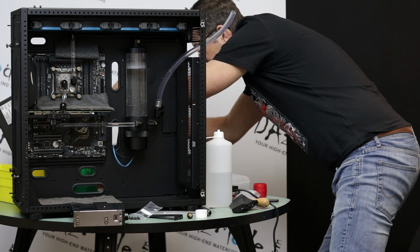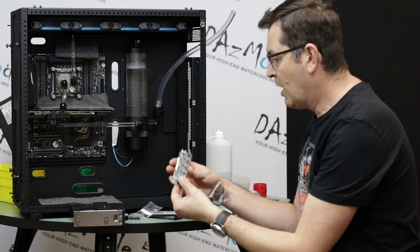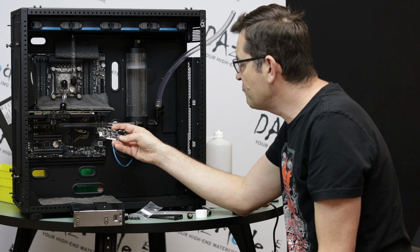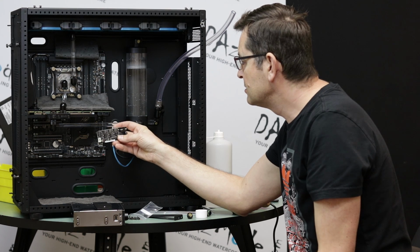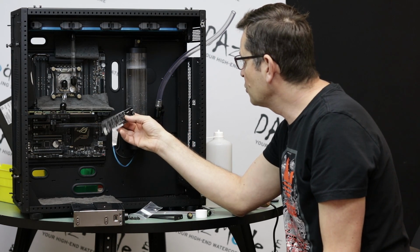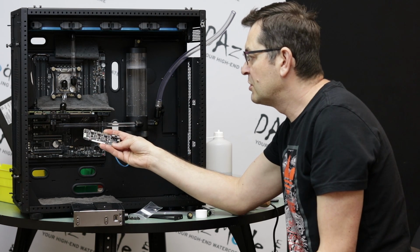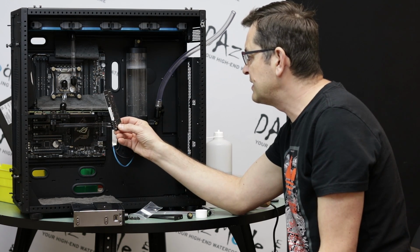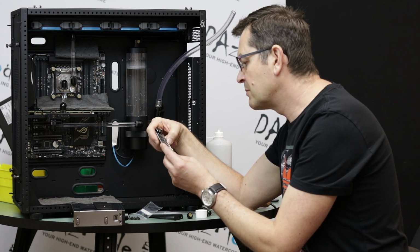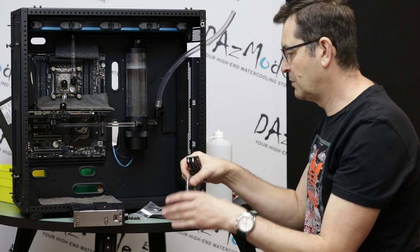Maybe somebody who already has the system can help me out and make a quick comment on the video. There's some sort of splitter powered with Molex and has a bunch of connectors, like 4 of them, for the fans. So this is already a 4 fan splitter, so that thing can be used for the radiator, for example, to control it, and the rest 3 I can just connect to the motherboard. So basically we don't need the controller at all, but if anybody uses the little board thing, I would appreciate if you make a comment for me. I understand that probably you need to connect it with some sort of USB or something like this to make it work, but I don't know. We'll figure it out later.